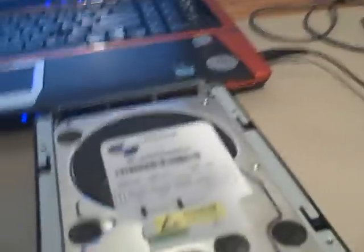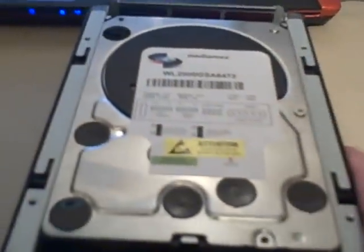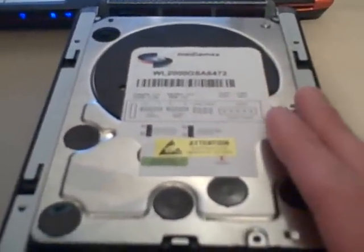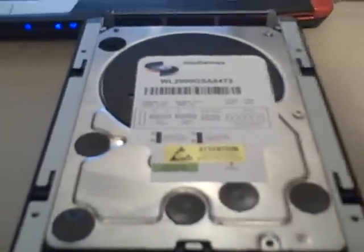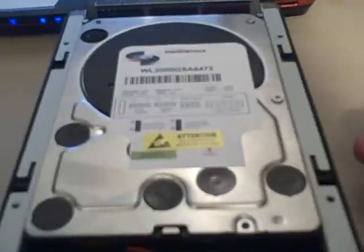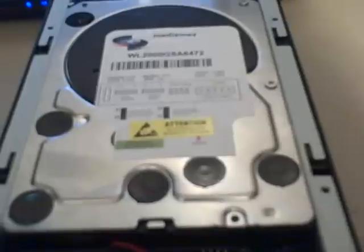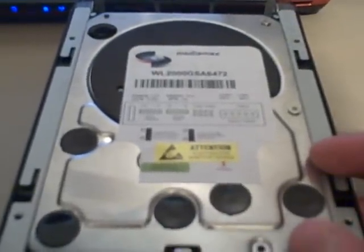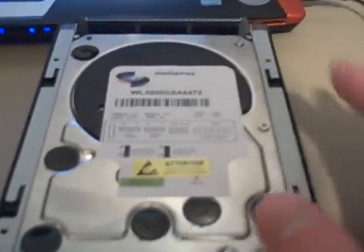Very fast performance. It does small transfers very quickly — it can copy to itself 60 to 65 megabytes per second, which equals 120 to 130 megabytes total transfer rate, equivalent to a sustained transfer rate on the outer edge. It utilizes its 64 megabyte cache very well and seeks very fast with its dual-stage actuator.